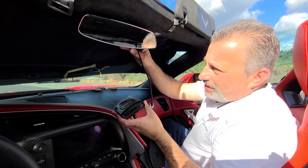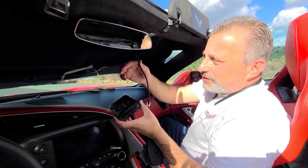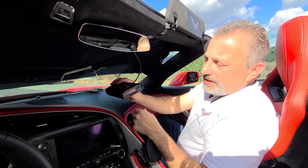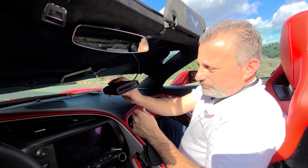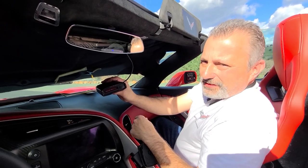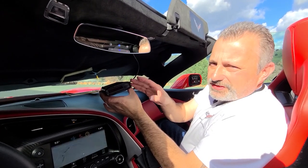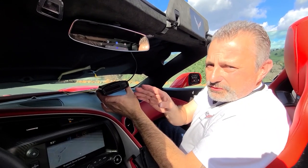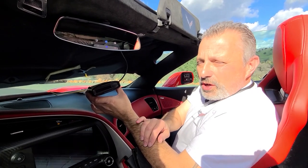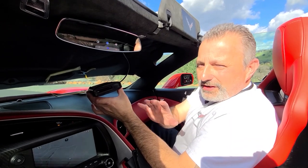Now that we've got our cover on, we just want to go ahead and test to make sure our circuit's still good before we put the bracket on. So we're just going to plug it into the radar detector again, and then John's going to go ahead and start the car. And there you go. Now let me point something out — when you're tapping into this and you go to do this test, you've got to start the car. You can't do this with just hitting the engine start button and it going to accessory mode. The radar detector will not come on. So you have to start the car, and then it actually energizes it — that way you'll know you have the right wires.